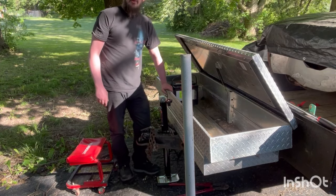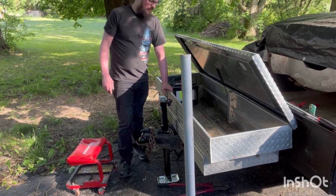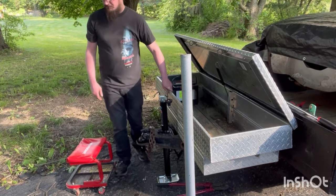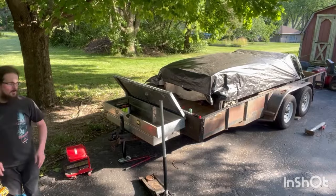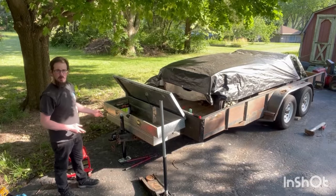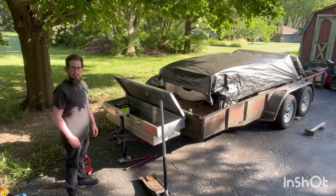Now, when you're doing a battery like this, you really got to check your top clearance, or make sure you're not arcing off the lid. You know, sparks are exciting, but not when it's not controlled. So, test fitting everything, I was really resisting it, but I think I'm going to have to punch a hole in the side of the box here so I can run the wires.